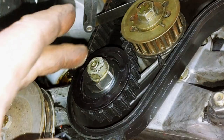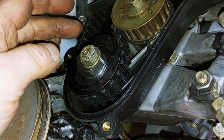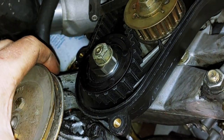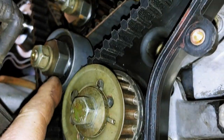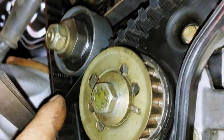Now that we have the balance shaft tensioned and the roller torqued and still checked correctly, the last thing to set is the idler pulley for the balance shaft. That is done with a half-millimeter feeler gauge — you basically just slide it in and out. Now it's just a tad snug.